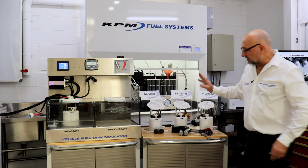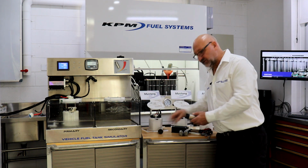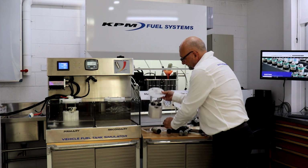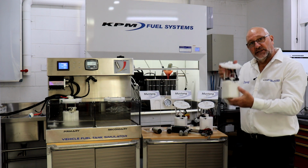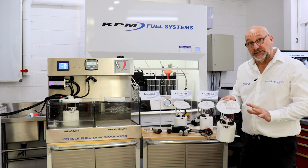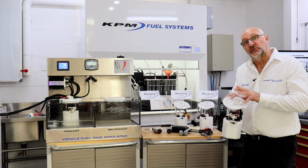We go up to our bigger system, which is the 1500 horsepower. Now don't forget, that houses two big Bosch Racing pumps to be able to run at 1500 horsepower. Now you can do the same thing. You can pop out your standard Mustang fuel module, pop that straight back in, plug it in, away you go. The only problem there is you can't run it off the standard fuel controller.